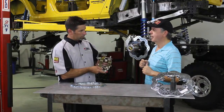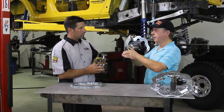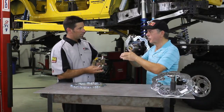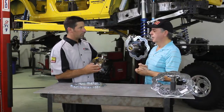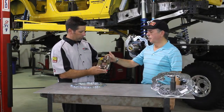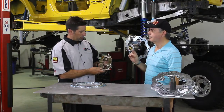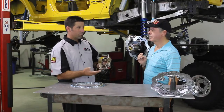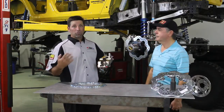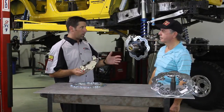The Belleville springs often cannot overcome the amount the caliper actually opens up when it gets hot. I've seen calipers open up an eighth of an inch, and there's nothing you can do to the piston to overcome that — it's going to clamp back down on the rotor and you'll still have drag. With our fluid system, piston design, and housing strength, this caliper at a thousand pounds of line pressure, fully heat-soaked, deflects only ten thousandths of an inch — which means the pedal feel is consistent all day when you're racing.